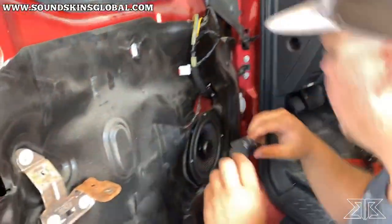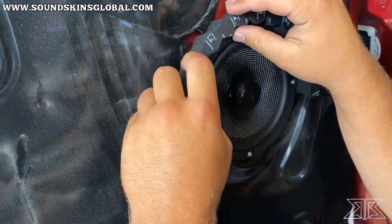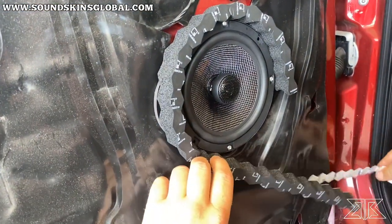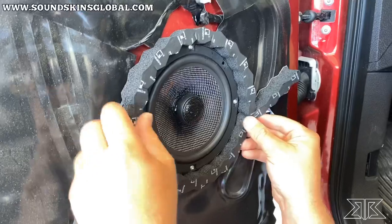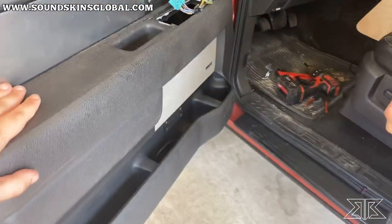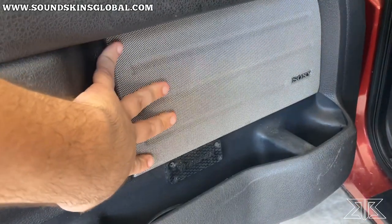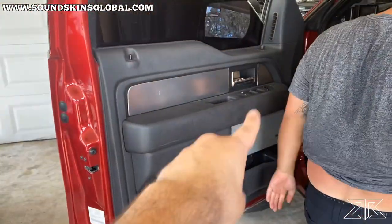We did the unboxing a couple of months ago, so we're going to try them out here. This is how you install the SoundSkins ring. The reason for these is it helps seal between the door panel and your speaker — nice and sticky — so that you get a sure-shot channel to the cab. Each of these doors is going to have one of these. You just pop on the door panel and now you have a stock look, but the guts on the inside are much better than what Ford originally put in there. The door panel fit nice and snug, with the stock door grille fitting up against the ring nice and tight.